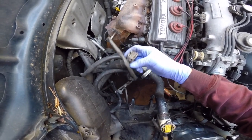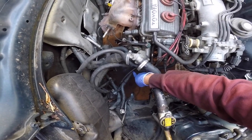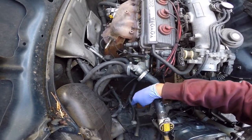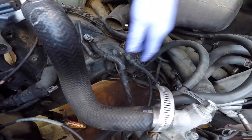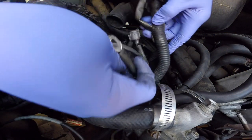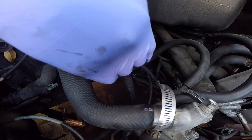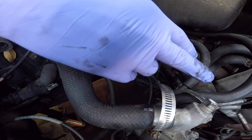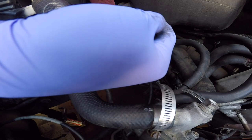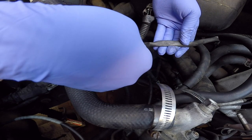I'm going to mount the camera and show you exactly how I pull this back and what I cut first, what I put together, and what I leave open so that the car starts. Here we go — the ground for the starter, the power for the starter from the relay, and then this is for the O2 sensor on the bottom end on the catalytic converter connected to the headers. This is for the trans — it's already been cut. The three wires are brown, white and black, and purple. Those you can just cut off.